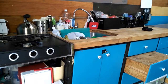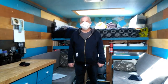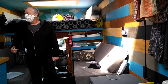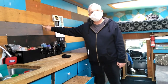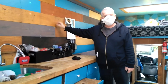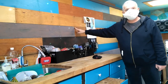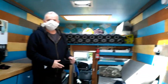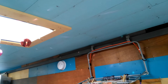Look at this kitchenette — one unfortunate thing about this is the construction. The kid who built it didn't do his homework and created a big problem. I'm going to have to tear the walls all out. All these screws that hold the paneling are screwed directly to the aluminum ribs, so they're whatever temperature the cold side is — the screw heads magnify that temperature. If the sun's shining on the side of the van, these screw heads all get hot. If it's cold outside, the screw heads collect condensation and freeze. There are hundreds of them, so during winter when I would sleep, all the screw heads surrounding the bed were frozen — it's like sleeping in a little freezer.